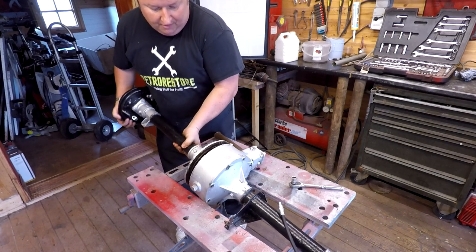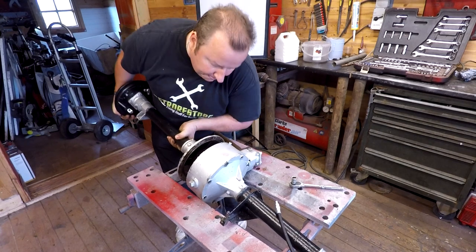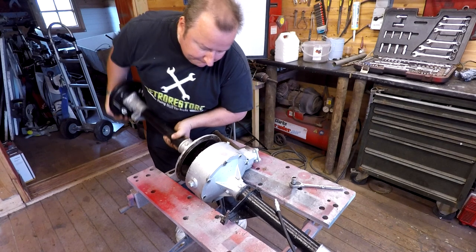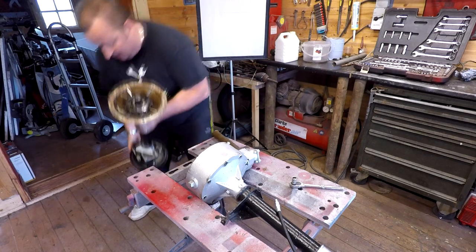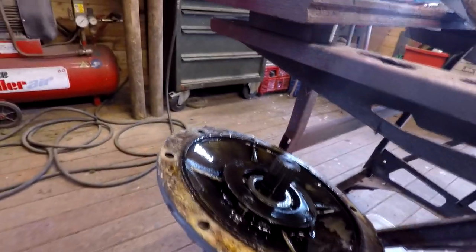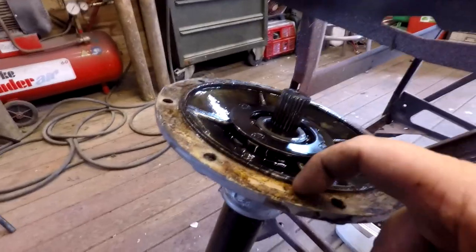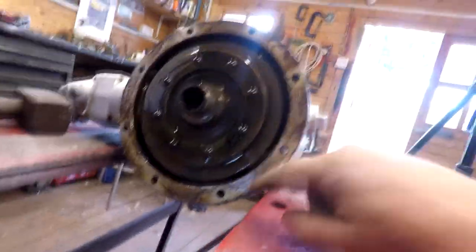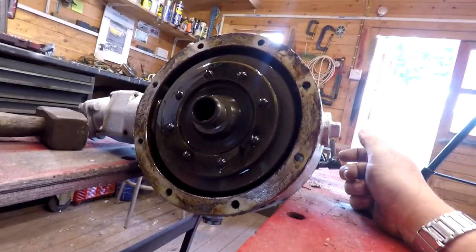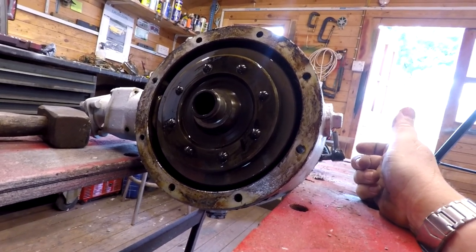That should come off on the drive shaft itself — there we go. So that's the drive shaft come out with that one. Let's have a look: it doesn't actually appear that there is a gasket on there — that's metal. And looking at this side, that's metal as well. I'm sure there should be a gasket in there, so I'm quite surprised by that. I'll just drift off the other side now.